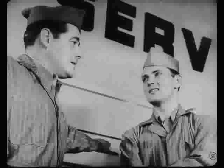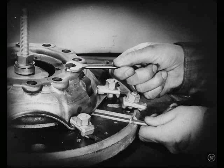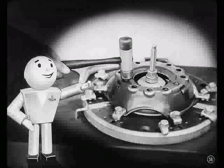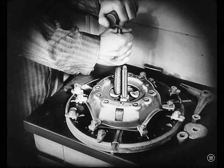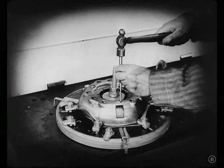Now, suppose you had to adjust the levers — what's the procedure? Well, with the cover in the fixture, first make a rough setting of the eye bolts. This moves the plate so the levers will be at the right height when the clutch is installed. Don't forget to tap the bolt sharply with a soft-faced hammer to seat the adjusting nuts. Then work the levers up and down to be sure all parts are seated. Make the final adjustment to ensure the plate is parallel, then stake the adjusting nuts. You ought to recheck the levers after that — staking those nuts may change the setting.